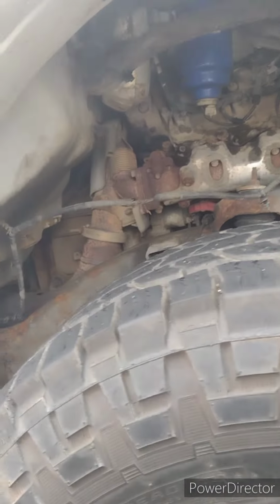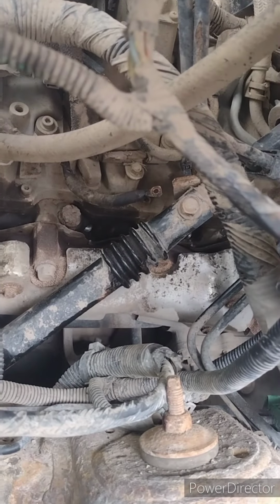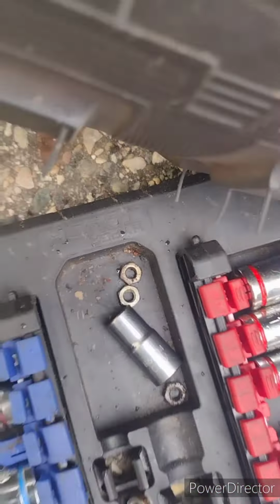We'll be back. All right, we're back on the 2009 Duramax. I got all four glow plugs out, and as you can see, the steering shaft is still there. Ask me how, I'll leave it to you in the messages. Boom. Don't forget to penetrate. Take your time, get it done. Make sure you have the extra 1/4-inch bolts for the tops, just in case they break. Good luck. Let me know what you need.